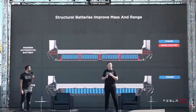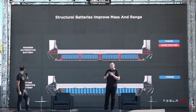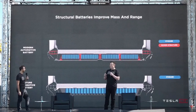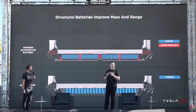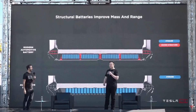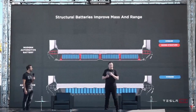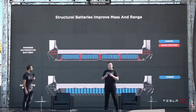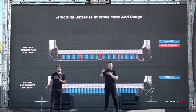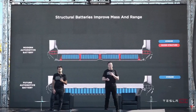This is really quite profound. Effectively, the non-cell portion of the battery has negative mass. We save so much mass in the rest of the vehicle — we save more mass in the rest of the vehicle than the non-cell portion of the battery weighs. So how do you really minimize the mass of a battery? Make the non-cell portion of the battery pack negative. It also allows us to pack the cells more densely because we do not have intermediate structure in the battery pack. Instead of having supports, stabilizers, stringers, and structural elements in the battery, we now have a lot more space because the pack itself is structural.